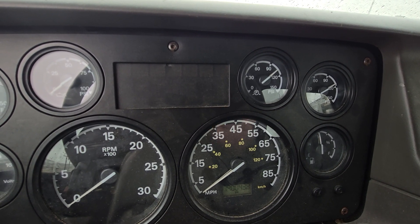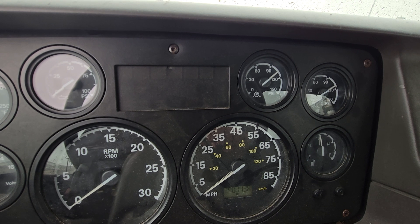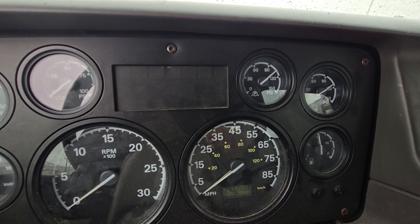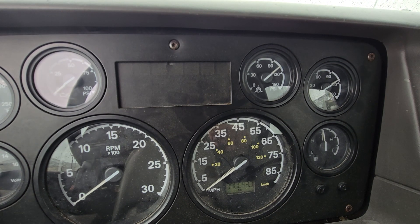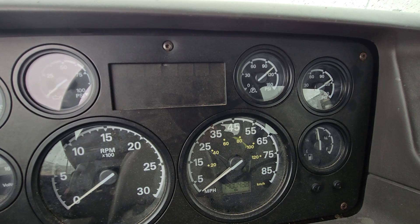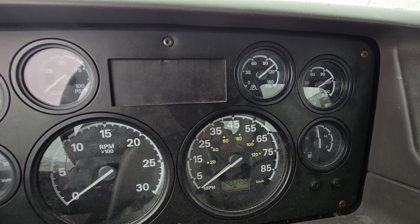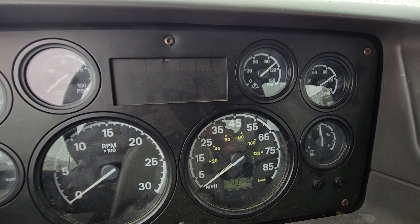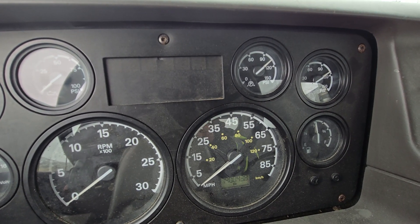I'm going to watch that for one minute and I should lose no more than 4 psi in one minute. You can use your phone, timer, or watch to time this during the test. You need to make sure you are holding that for one minute with the service brake fully applied — don't move your foot on that brake, pushing it any harder or releasing it, as you could artificially lose air and not have a good test. If at any point during the air brake test you do something wrong or forget something, start over from the beginning: start the engine, build the air pressure all the way up to governor cutout, and follow steps one through four.